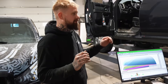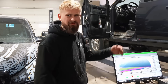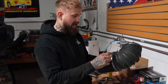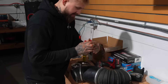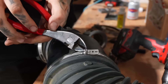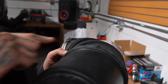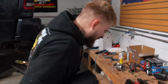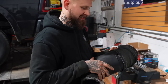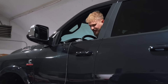I think we should take out that resonator in the intake pipe, then take it for a drive and maybe do one more dyno run. For removing the baffle, you're going to have to take this big hose clamp off and you won't be able to reuse it, so you'll need to get another one. I just use side cutters and deform it, try to twist it - there's really no good way. When you put it back together there's a little arrow there and a little arrow there - you just line them up and pull the baffle out.